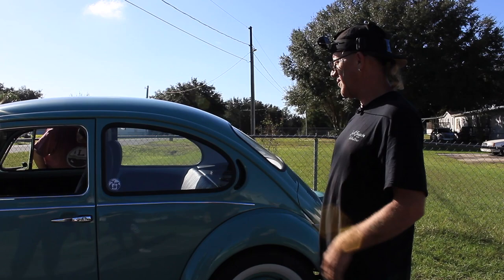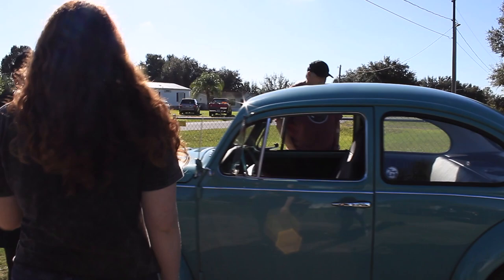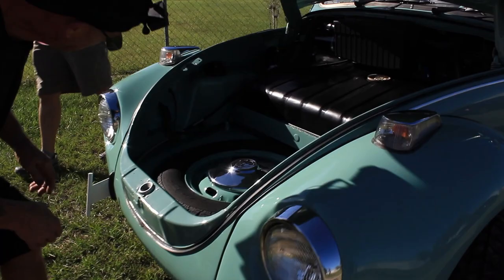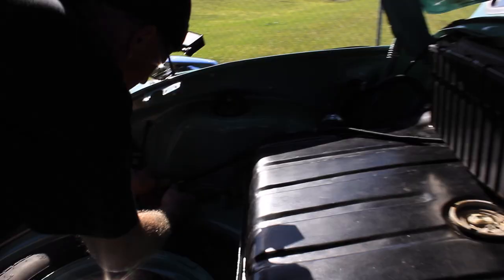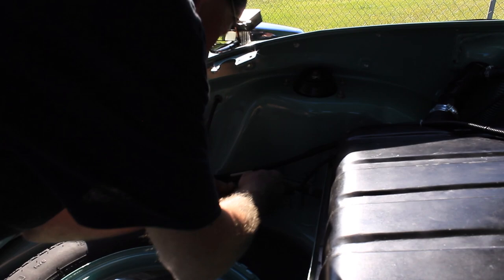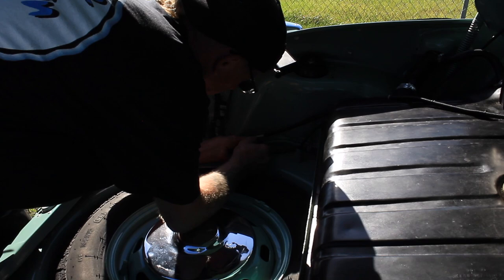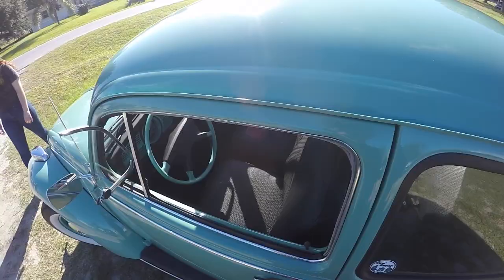That's why I show you where the fuse is. If it starts to do that one time, you're not going to use them all the time. Use my little secret entrance. It's so much easier than running over there. I just take the fuse out and put it behind the cap that goes over it, and put the cap back on and it holds the fuse right there. It may not do it again because the plugs are facing up. That's something I've always seen when doing road calls for equipment. It's usually moisture getting in a plug for something to do something like that.